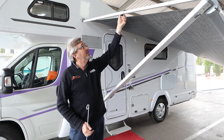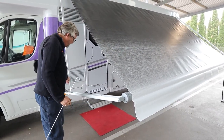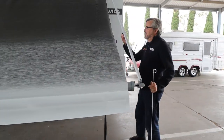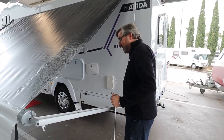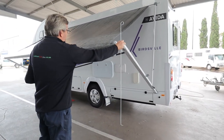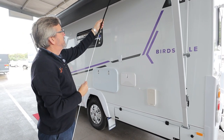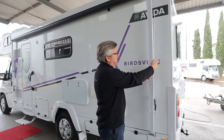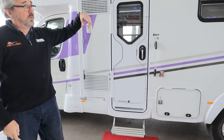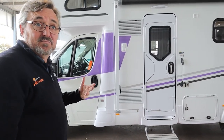If it's going to be windy, put it away. Loosen that off, bring it down to height, push that with your thumb. If it's already gotten windy, somebody has to lean on it so it's not fighting you. Do the same thing on this end — loosen it, push it with your thumb, slide it out of the way. Grab your strap, pull down a little bit, flick that switch. As soon as it starts winding up you need your hook ready. Grab onto your strap, let it wind up so it doesn't make a big bang. Lock it in, do it up both ends. Your awning is still trying to wind up so it can't come out by accident. These clips are in so it can't rattle out by accident. Practice that if you can — makes you look good when you get there.